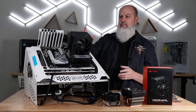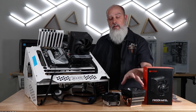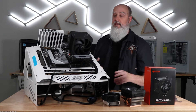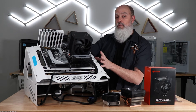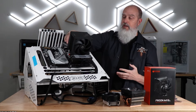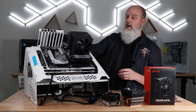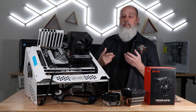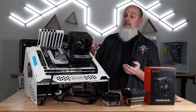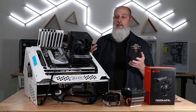As far as performance, I did a couple of basic tests. I tested this on an X570 motherboard with both a 5600X and a 3800X CPU from AMD, and compared it to the stock coolers. I left it on stock BIOS with everything on auto, applied the XMP profile for RAM, installed Windows, and updated all drivers and the latest BIOS. For the second set of tests, I applied an overclock and set all the voltages to reduce auto settings. I managed ambient air at 21 degrees Celsius. For each configuration I did three tests: one with fans at 35 decibels at 20 inches, one with fans at 100% speed, and one at idle.